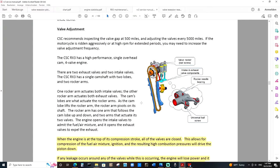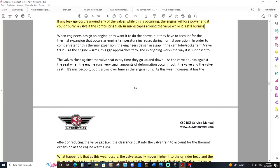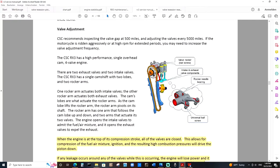In this section of the video, we're going to be taking a look at why valve recession is so dangerous. But in order to understand that, we need to also understand what normal valve wear is supposed to look like, and why we do valve adjustments in the first place. I encourage you to take a look at page 45 in the RX3 manual. This is the page that talks about the valve adjustment and gives a general overview of how the valve train in the RX3 works. The valve adjustment interval for the RX3 is about every 5,000 miles.